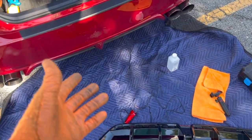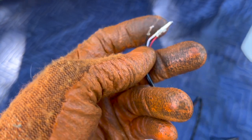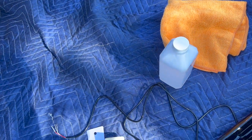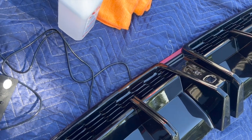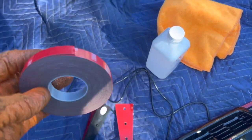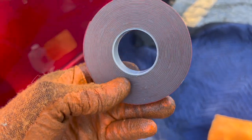You'll want to pop the bumper down to get the brake light underneath. The main part of this video is showing you how to wire the brake lights to your taillights so the brake light is functional. The sticky-back tape came with the kit — it goes on the brake light so it stays stuck to the bumper. I also use 3M tape on anything.